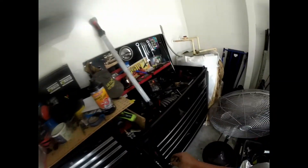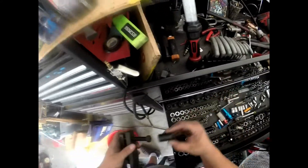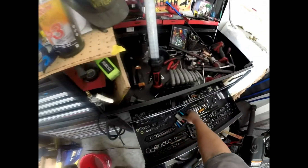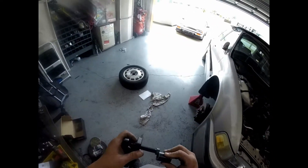So I got the car on the air. You're going to need a 19. This is the ball joint separator — I took out the axle. So basically this goes right here like that, and you see how you cannot reach? You take this out of here. There's an adjustment on it. You can buy this for 20 bucks at Harbor Freight. And then you find it here — basically you put that through there.